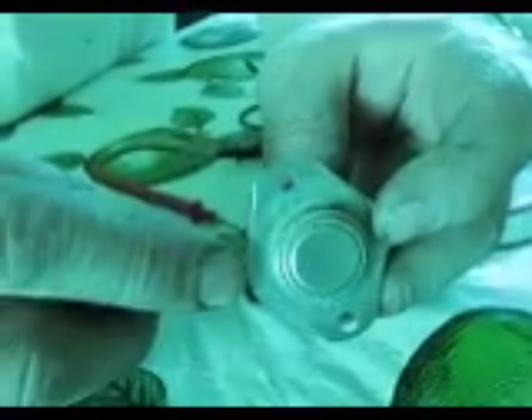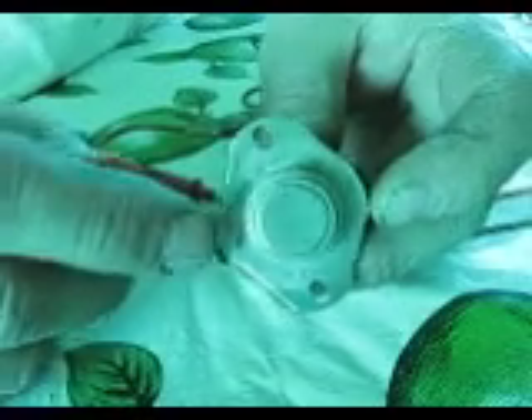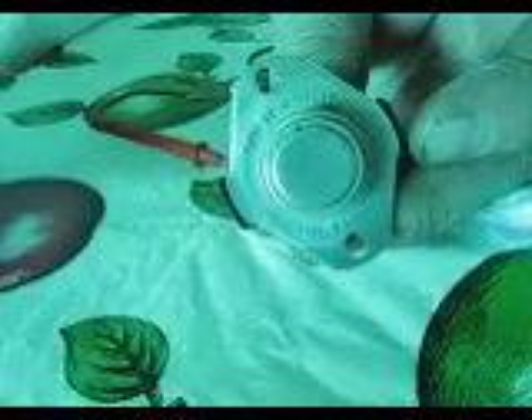When the temperature cools down again, it'll close and we have continuity again, just like when I touch my leads on these contacts in normal air temperature. The insides of this is just bi-metal strips — different types of metal that bend with heat — and then you have no contact, so it's like shutting off the switch.